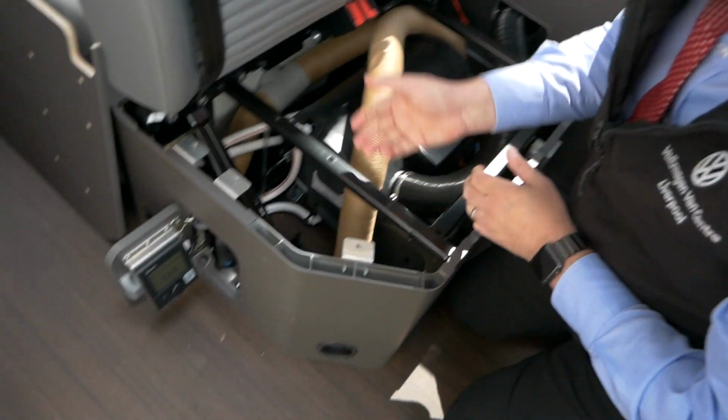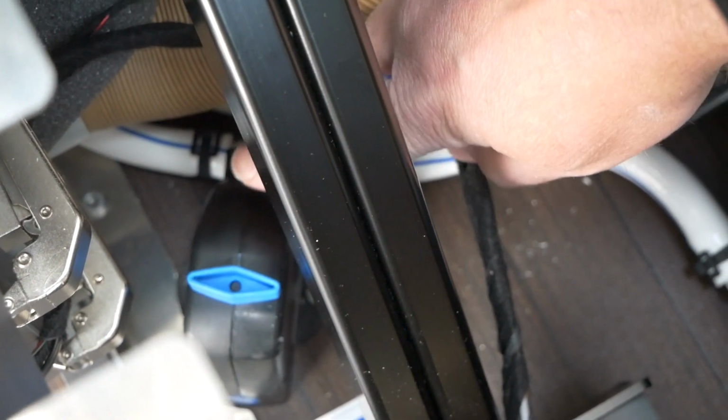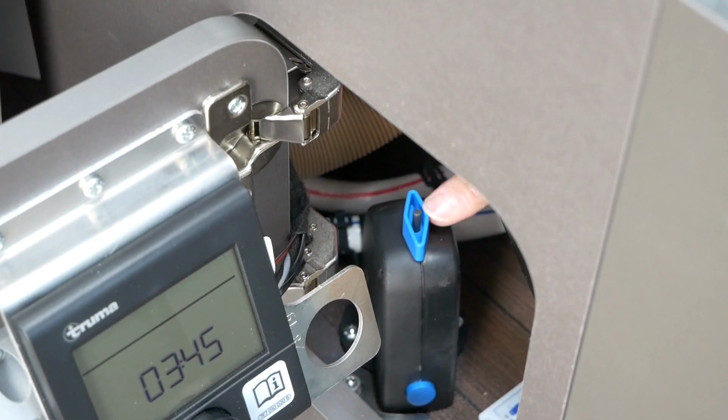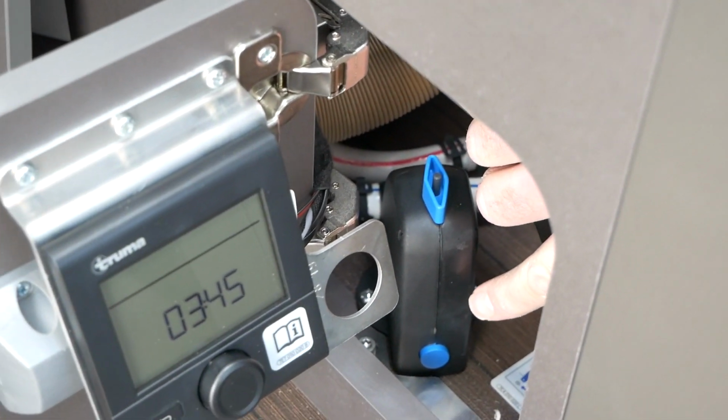And then finally our frost protection, which we've done videos on before, but it's a lot easier to see it in here now because obviously we've not got the top of it open. So that's our frost protection. This at the moment is closed because it's in line with the pipes that's here. If you were to open it, you would just twist it like that, and you can see now that's twisted, so it's popped up and the blue at the bottom's come out.